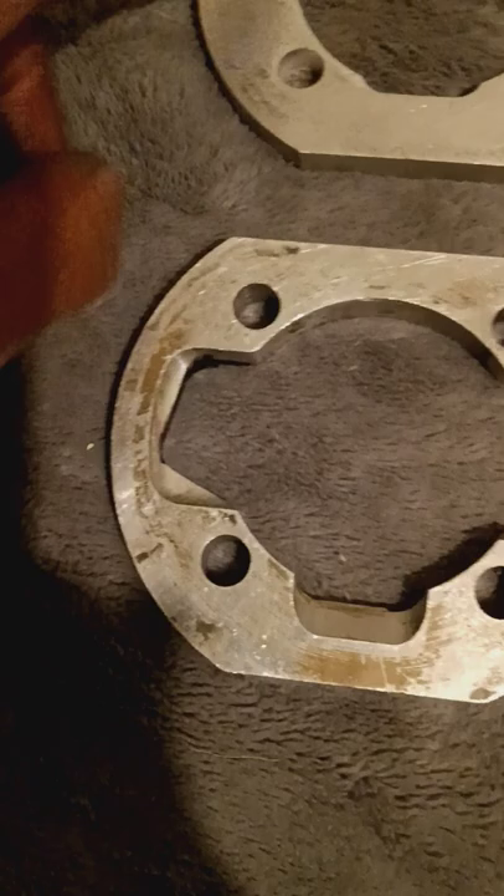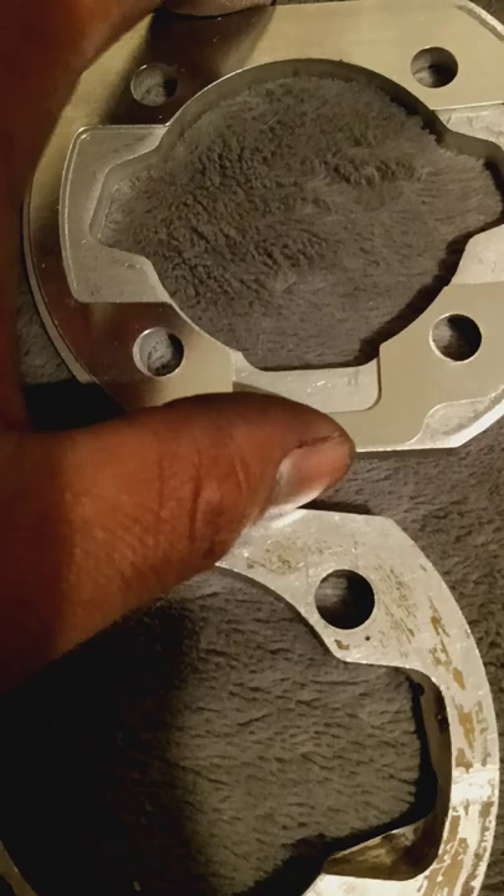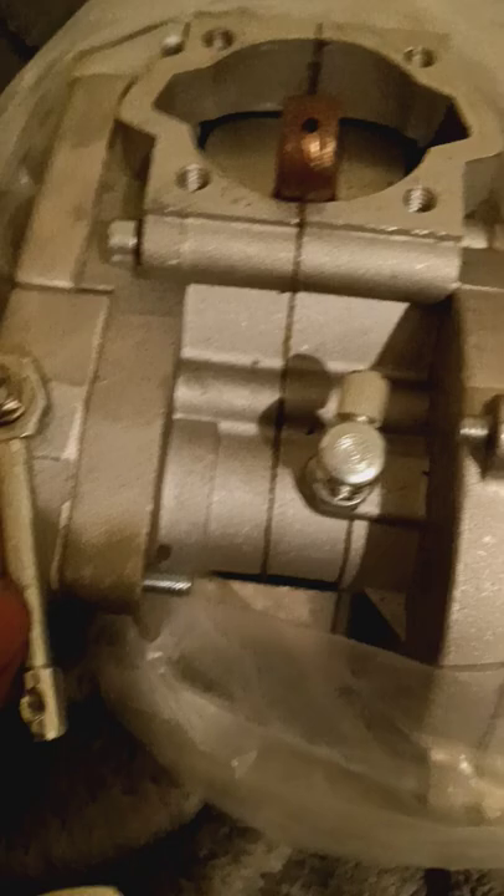After that I could basically do this with whatever material I have left, by sharpening it on here and going in at an angle - like a 45 degree angle - as well as the intake area. That should be pretty good. I'm going to have to do that because I am playing with a short rod, 40 millimeter stroke. Sorry for the long video, but I'm wanting to get my point across saying that if you do go with a short rod you're getting this - it's not as pretty as these other spacers.